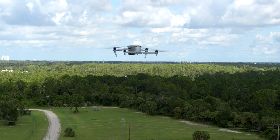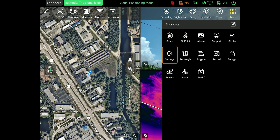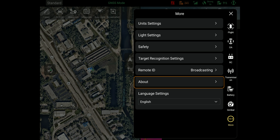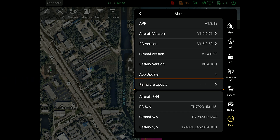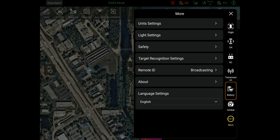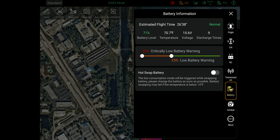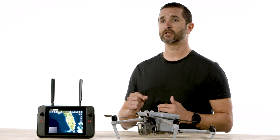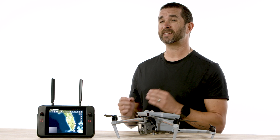You can update your firmware by powering on the drone and the remote, navigate to the settings page, click the about screen and click where you see firmware. Make sure you are connected to Wi-Fi and the screen will prompt you to install this new update. This is a larger update so make sure your remote and the aircraft are powered up above 50% battery level. Once the update is complete, you will see an update success message and you will need to restart the aircraft and the controller.